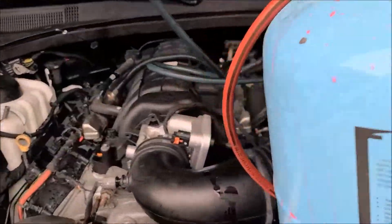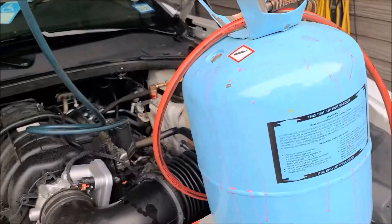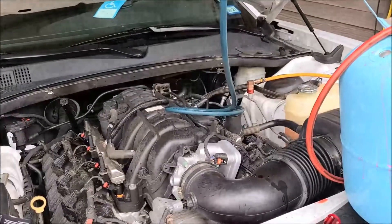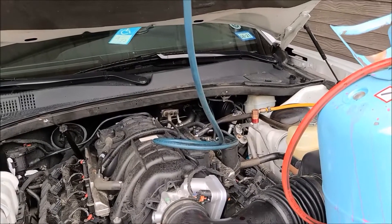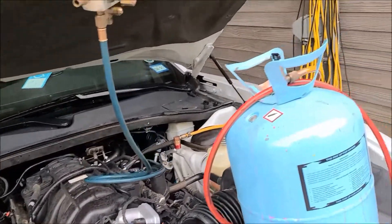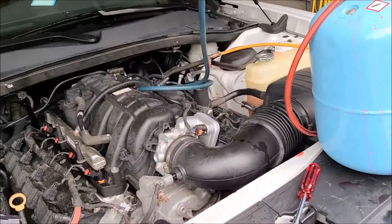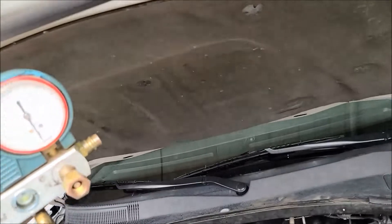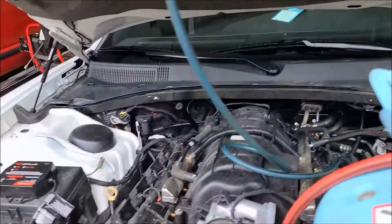We are dealing with R134A and I've done this car so many times I'm getting pretty good at it, unfortunately. It only lasts about 30 days, so we'll see if we get more than 30. Supposedly if you have a small leak like that it'll fix it. I tried using a thicker charge oil — 150. I put in 40 milliliters, a little over an ounce, an ounce and a third of 150 PAG. I think it calls for 46 or 50 — whatever I had handy I used.